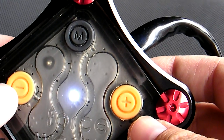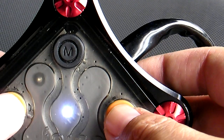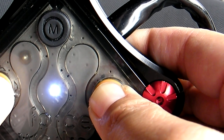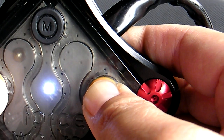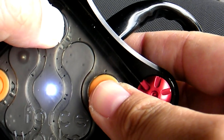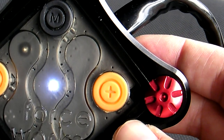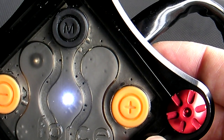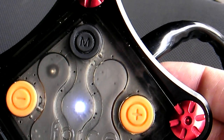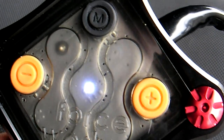So now I'm done. I'm going to lock the unit by holding the minus and the plus sign for five seconds until it flashes. Let's go back to mode one and lock it. Now it's flashing like a heartbeat — flickering a little bit — that's when you know it's locked. That is it. My next video I'll have the scooter on a dyno and show you how to tune with the air fuel meter. Good luck.